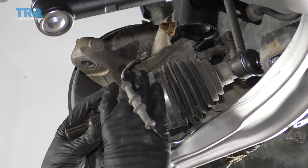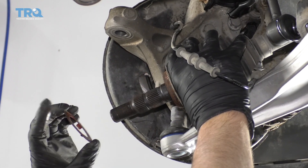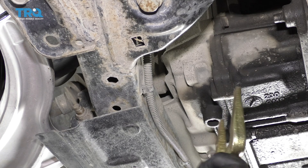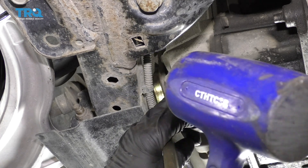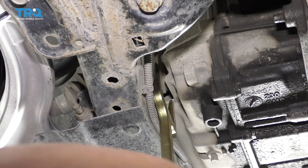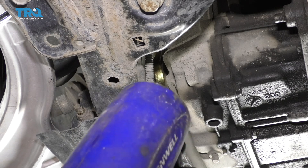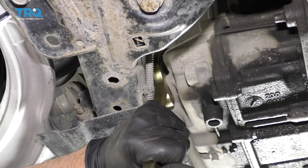Just keep in mind there is going to be a washer or spacer right here — you need to install that on the new one. I put a drain bucket underneath the transmission and I'm going to use this axle fork to remove the axle. Just get it in between the transmission and the axle right there. You could also try to use a pry bar or even a couple of pry bars, and then just give it a tap.